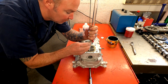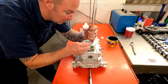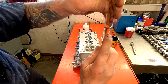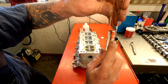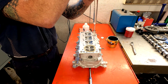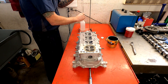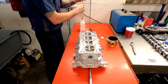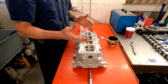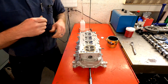If you make a mistake here you have to start over. Fill it right to the bottom of the plate. That is right at 35 cc's — 35.0. So you need a very accurate burette to make this happen. Now we also need to know the bore size and the stroke of the crankshaft. We'll go into the office with all of our calculations.